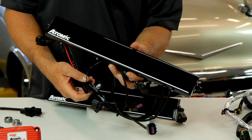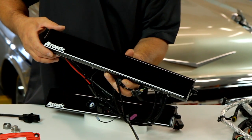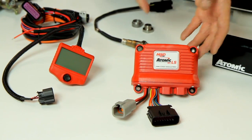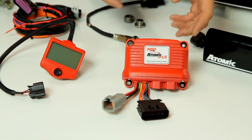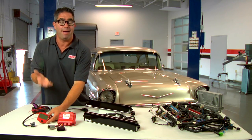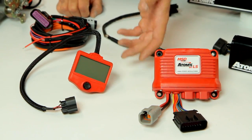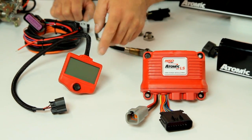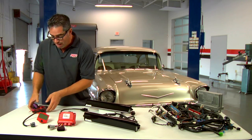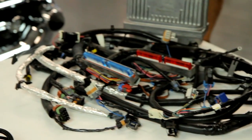It has the normal amount of sensor connections as factory stock, but without the excess wiring, without the bulk and mess. The fuel rail ECM units are connected to the power module, which also runs external high-load things like the cooling fans and the fuel pump. The controller replaces the need for a laptop computer. All you do is answer a few car guy questions about your vehicle and engine combination, enter them into the controller, and you are ready to go. The wiring harness is included — look how small it is. Compared to the bundle of snakes that is the factory harness, this truly is do-it-yourself heaven. The system also includes a high-quality wideband O2 sensor, which we're going to install in just a moment.